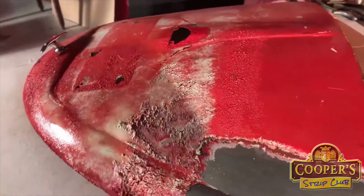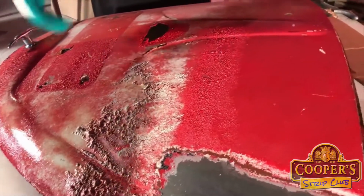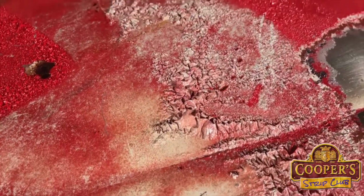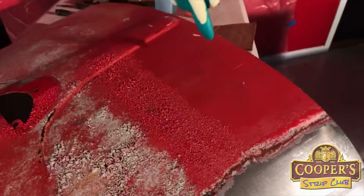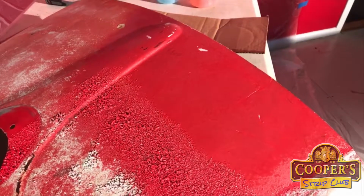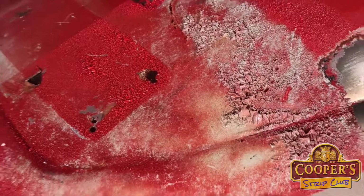So you can see, a lot of people think paint stripper has to bubble like this stuff. It looks impressive, but I actually prefer it to do what it's doing up over here on the red, where it actually spends longer getting through all the layers, rather than a quick bubble. As I say, looks impressive, but it pulls the stripper away from the other layers.